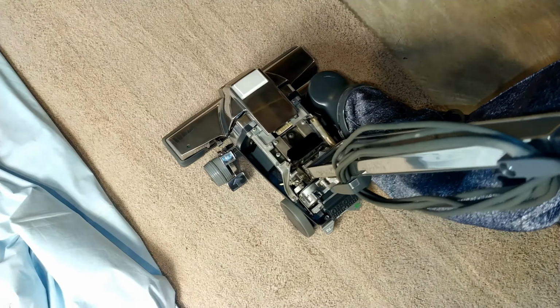Much faster. Oh, fantastic. Okay, so motor bearings are in great shape. So let's drive it and see what happens with the transmission whine. Okay, obviously that did not help the transmission whine at all, and I can't say I really expected it to because we didn't touch the transmission.